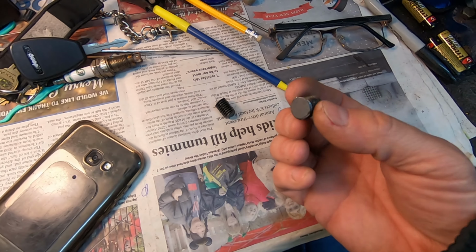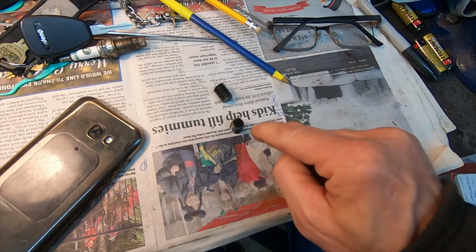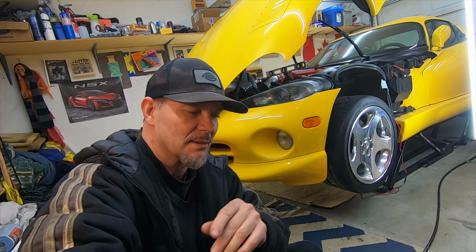All right, this is what I mean. I had to cut off the ends of the bolts of the motor mount in order to get that sucker in. All right, a job that should have taken under a day has taken me 3 days to do because of the difficulty. And the real answer is because I have aftermarket headers on this Viper. I've got Belanger exhaust headers, full-length headers, and they take up more room in all the spaces under the sill